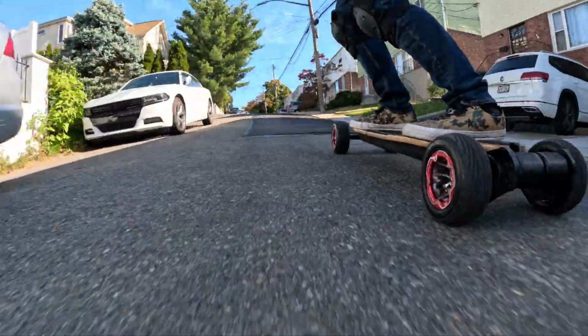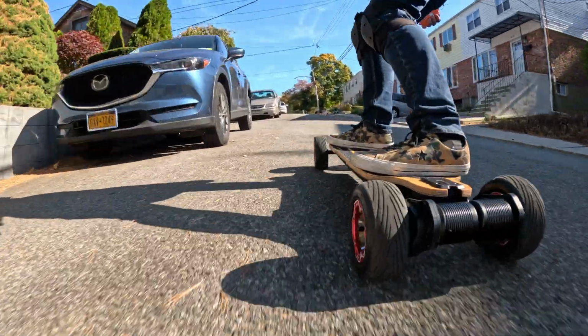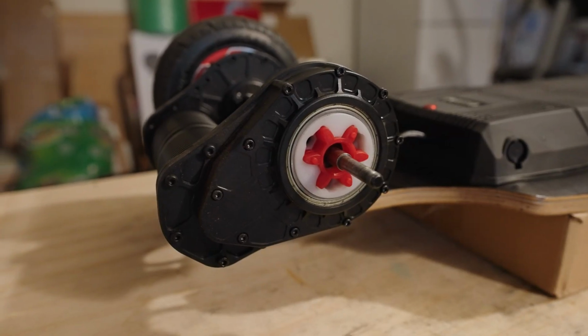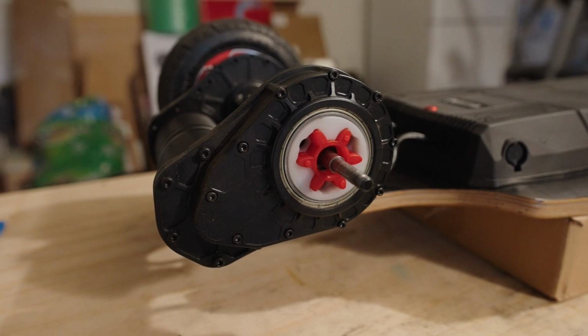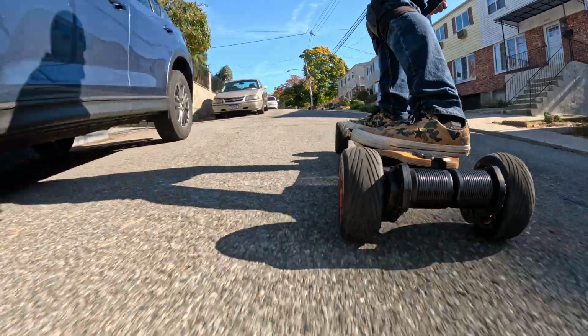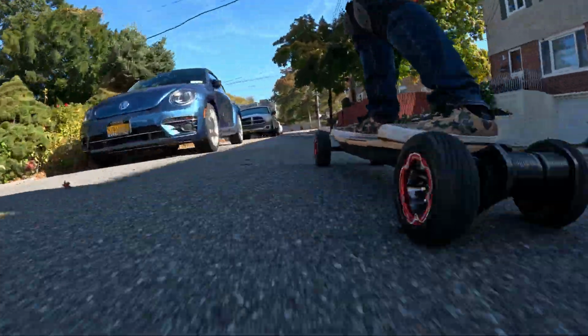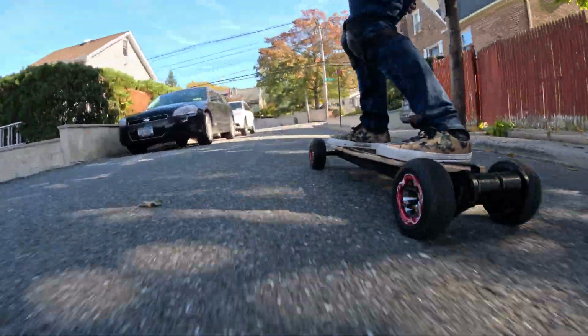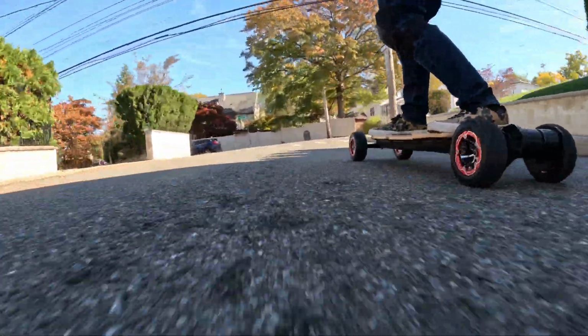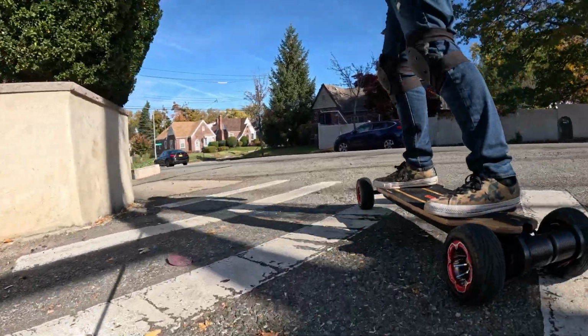And so these gear drives are pretty good. These gear drives in particular have what appear to be, I assume, a hard urethane buffer type of cushion thing that engages the wheel adapter against the wheel gear, and it is billed as being an impact mitigation device. So when you have a hard acceleration or deceleration or a swap between the two, the impact felt by the gears inside the gearbox is lessened by that cushion. Presumably this reduces the wear and risk of damage to the gears inside the gearbox. The idea behind it makes sense, and so at least there's that.